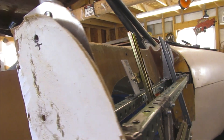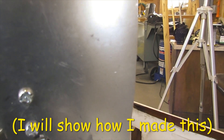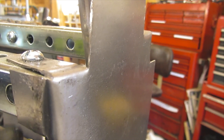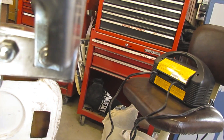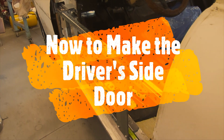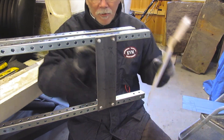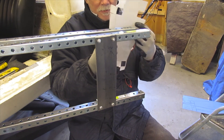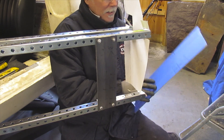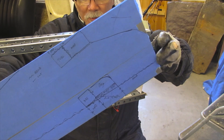I'm going to take the inner door panel off. You can see the end plate that I made that matches the contour of that inner door skin. I used that template to go ahead and cut tabs to fold over and hold all of the perforated tubes together. This plate serves to hold everything together, but it's also where you mount the door latch. Now I have the second inner upper bar in, with my template that I use from the other side — I just have to bend everything the other way. When I test-fit it here it looks pretty good, so I've traced it on a piece of 16-gauge steel and will go cut it out.